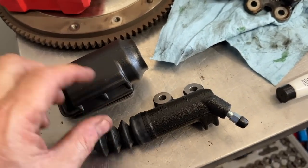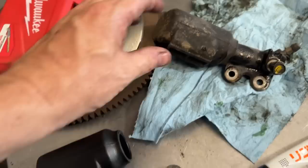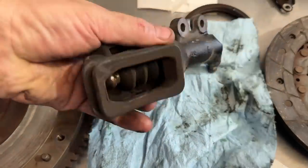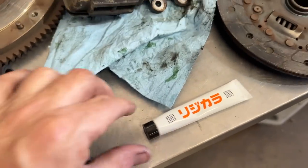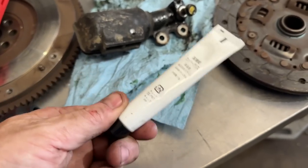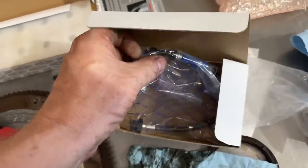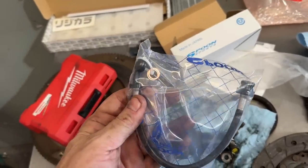This is the new slave he supplied, and this is the rubber boot — we usually recommend you replace this, we include it in our install kit, because the old one usually gets really crusty. This usually breaks off and it keeps all the weather out of your clutch area — it's very important. There's a reason Honda spent so much time designing this. He also supplied this — if you know what that says comment below because I have no clue, but it's really cool. He has the Spoon clutch line to go from here to the body — there it is, in a cool bag with new washers.